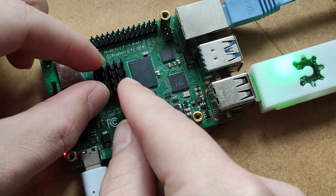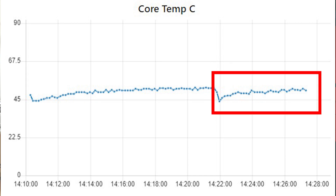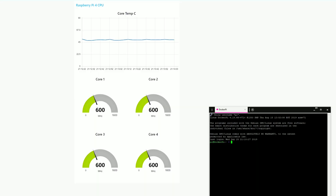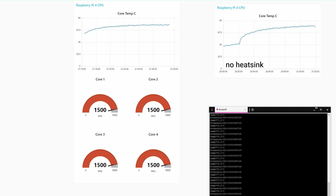In my second run I introduced passive cooling, which in this case is a mini soft adhesive heatsink. This heatsink may not inspire confidence, and you would be right, because it doesn't do much as soon as it's placed on the CPU. There is a small decrease in temperature associated with something cold being placed on the CPU, but the temperature quickly ramps back up to the standard 50 degrees idle. As soon as you start a benchmark, though, the heatsink does help and lowers the temperature during the benchmark by about 1 to 3 degrees, which actually avoids thermal throttling entirely.